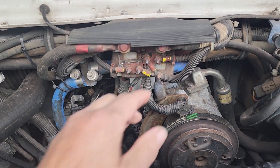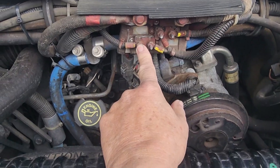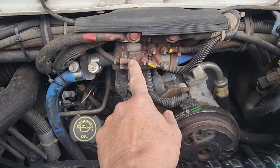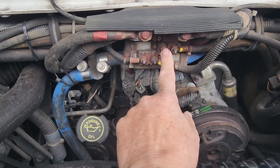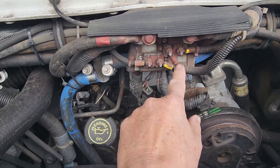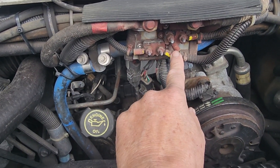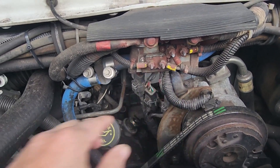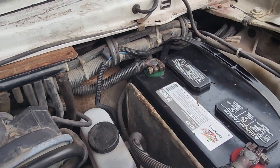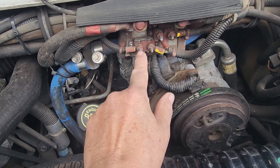I did find a problem with the old charging system and bypassed it totally. He had two leads coming off the old battery charger, one for each battery on the left and right-hand side, and they went through resettable circuit breakers. The breakers are totally rusted out. Whoever installed this should have never done it — it's got all sorts of water and weather damage. I thought it was a very poor idea. If you have something like this on your vehicle, I suggest you take it out and change it. Make sure the batteries are tied in together and don't have resettable circuit breakers underneath the hood.